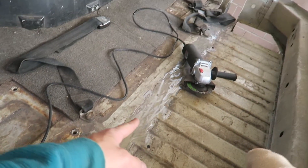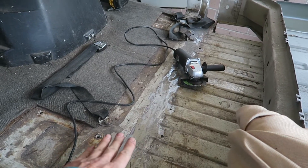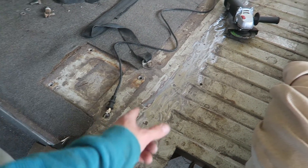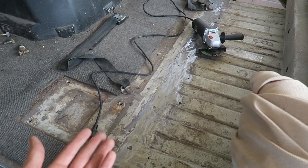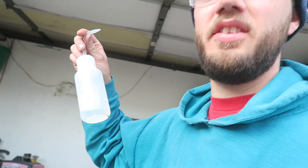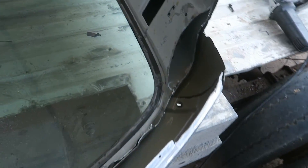The worst part was this line all the way across — there was tar from the people who made this into an RV. They put a layer of tar where they had the wood at, separating the cab from the living quarters. You couldn't grind it off because the grinder would just melt it. I had to use a putty knife and acetone, slowly inching away at it until I got it all off, then went over it with the grinder. That part was a pain, but it's done. The cab is just about ready to finally get mounted so I can start throwing some welds on it.